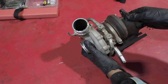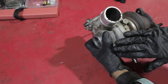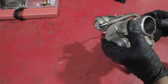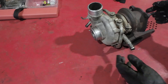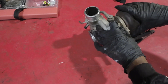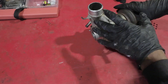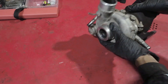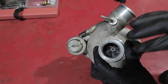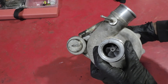Turbochargers are commonly referred to as having a hot side — the exhaust or turbine side — and a cold side, because that comes from the inlet air coming through. However, turbochargers by their inherent nature create heat. Basically, you've got hot exhaust gas going in there, which creates heat in the turbine and the turbo system. That heat transfers through the metal, and also when you compress air and squeeze it up, it creates heat. So compressed air is very hot. You may be thinking — why is that a drama?